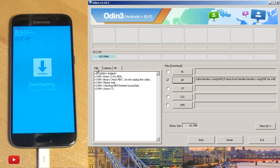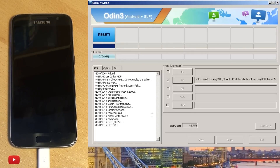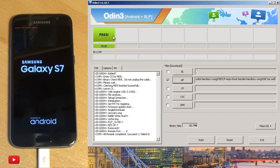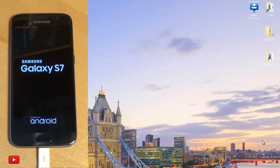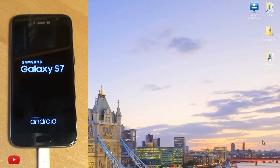And we can now hit Start. Here we go. You can see it's going to go through this process fairly quickly on the phone as well, and you'll go through the downloading process. We've got a PASS on Odin here to say it's finished and it's successful. Then the phone will start to reboot. We're done with the computer, so we can exit out of Odin and then return to the phone once it's finished rebooting. It may take a little while for the first time after it's been rooted, so just be patient and give it a little bit of time.